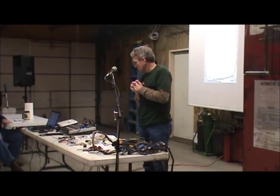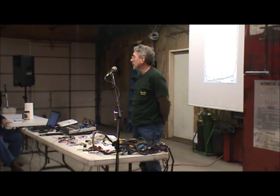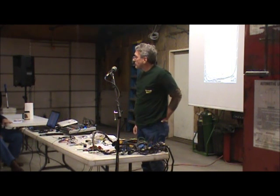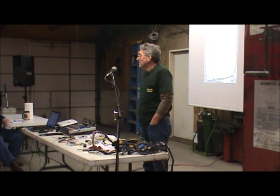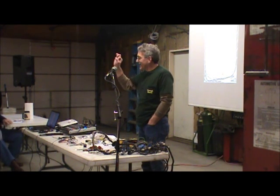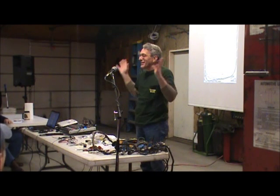I think sometimes a lot of people will try to go for a green wire underneath the dash, because green is hot. But green's already doing a bunch of stuff, so you start plugging into this and it's more inconvenient when you turn everything on. Yeah, you look at the wire harness on the TR3 and they take one tiny little wire and it's here, and it does everything. It's like, oh my God, what keeps this thing from just going woof, and the whole car just goes up.